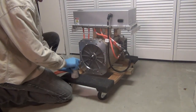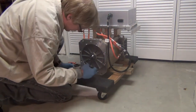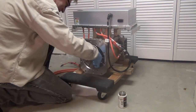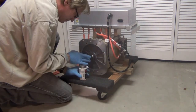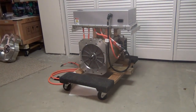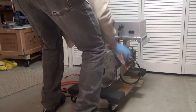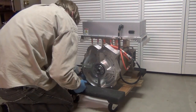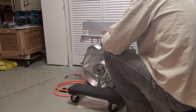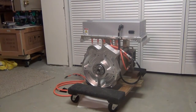Here I am putting some anti-seize compound on the Siemens spline before I attach the Rebirth Auto adapter. You can see the DMOC staged on top of the Siemens using some 2x4 wooden blocks. You can also see that the Siemens is rotated so the electrical connections are on the side. This is the motor orientation I had to use because the Rebirth Auto adapter was not machined to have the Siemens rotated with electrical connections on the top. On the side, they'll just have enough room so that I can make connections inside the car.